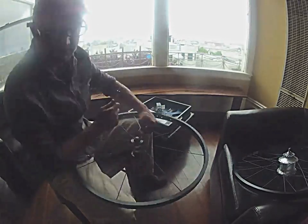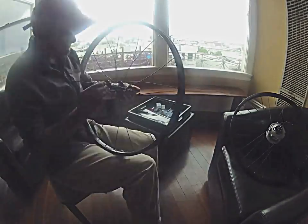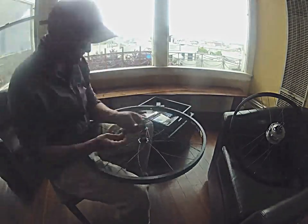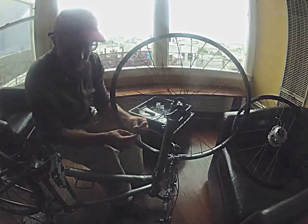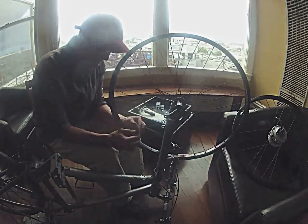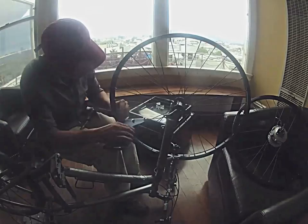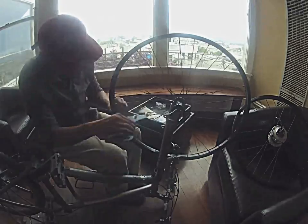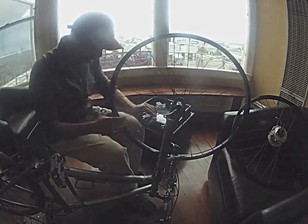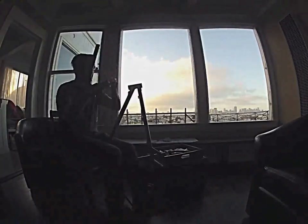Next off, it was time to build a wheel solo. Using the first wheel as a reference, I built my front wheel. This is the free spinning front wheel on my bike. As you can see, these rims are 26 inches, always known as the standard mountain bike rims. I always tour on a mountain bike because I do most of my touring off-road, typically through mountains or forests because that's where the world is most beautiful. So this is me gradually putting this wheel together. You can see those spokes are curved to begin with — that's because of the way that they weave in and out. That weave means that they spread the tension among multiple spokes, making them less likely to break, and as you can see it comes together with the spokes straight and hopefully even tension.